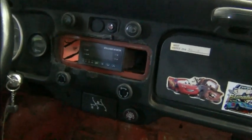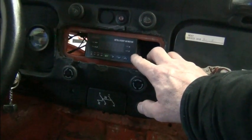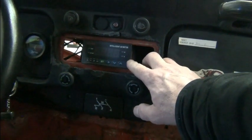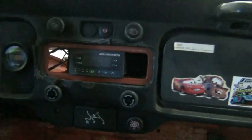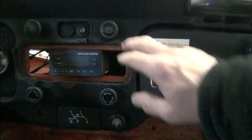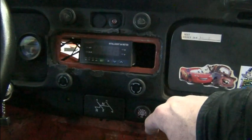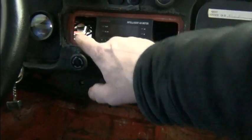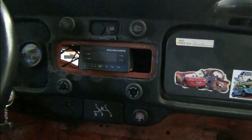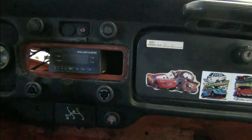Part of the control circuitry is the JLD 404, which will control our low voltage cutout. If the battery pack gets low, it disables the vehicle by shutting off the KSI signal. There are holes in the dash for it — we're going to make a black ABS surround that actually matches the padded dash nicely. We'll have a reverse switch and coast switches on either side of the JLD 404, kind of like it looks like a radio unit.